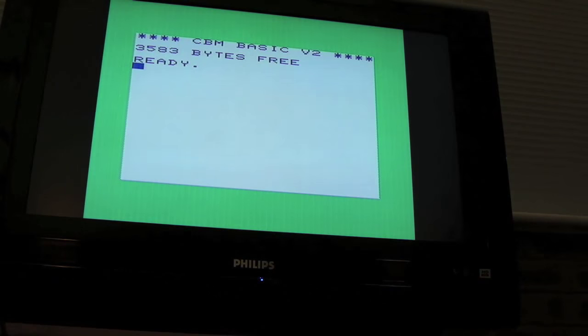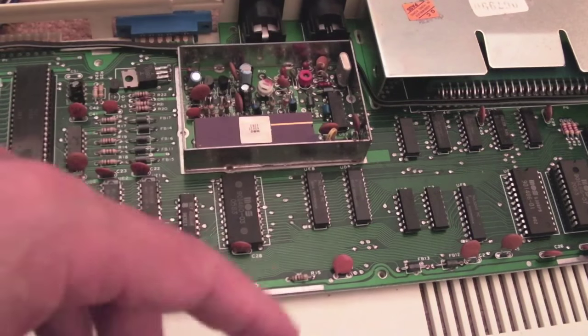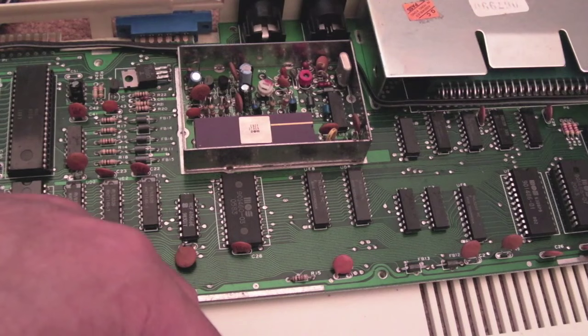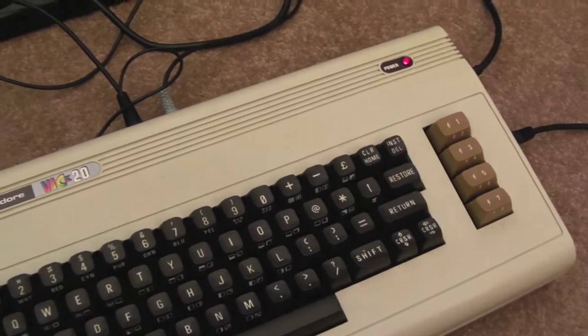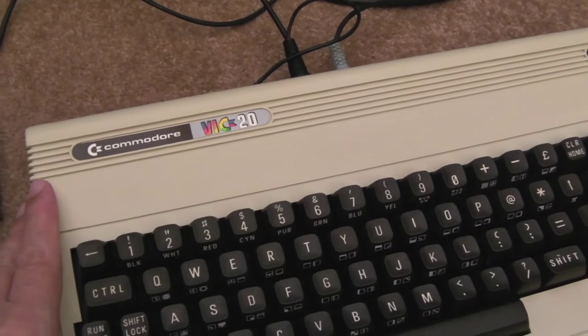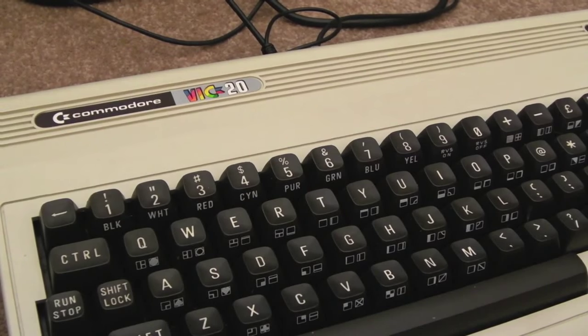You'll see it's working fine. The display is not great — there are a couple of mods you can do which I'll probably do to tidy it up. For now I'm going to focus on cleaning this up, heat sink that VIC, and start to reassemble it using the better case rather than the scratched-up one, and swap the keyboards over. I will also come back to the other Vic-20 at some point, remove some shielding, and see if I can get hold of a VIC chip to get that one working too. I've recased it now — put the decent keyboard with the decent case and the working motherboard.